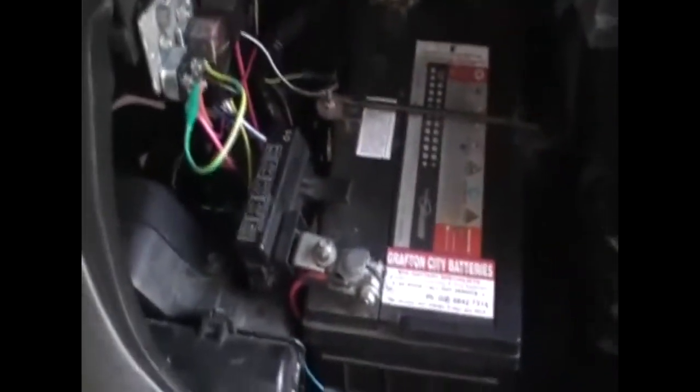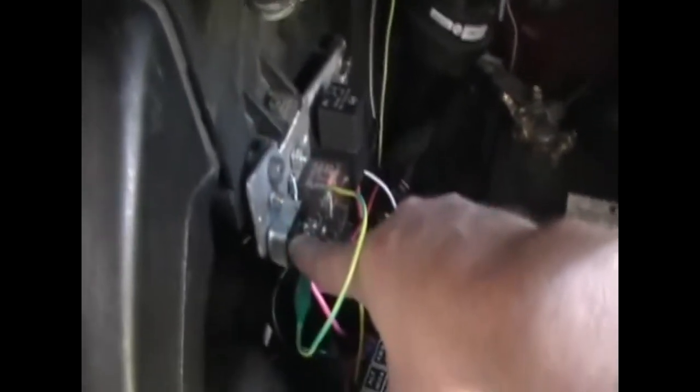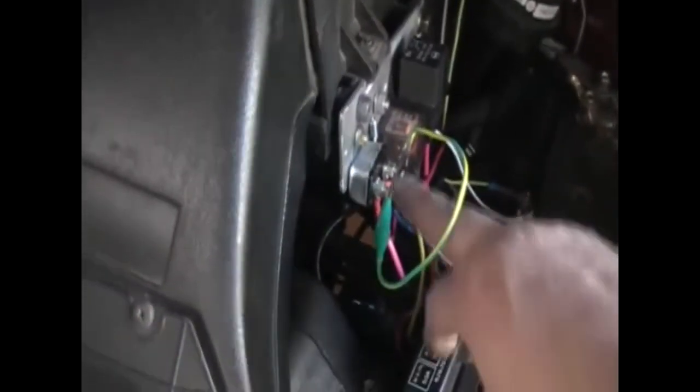So where I'm at: I'm not connecting the timing light up to the van's battery because the cable length won't reach far enough around the front — being a mid-engine van, it's a bit far away. So I'm using a motorbike battery on the side of the van to fix that. I also had to sort out an inline fuse that trips out and stops the fans working even when the van's overheating, which is no good.